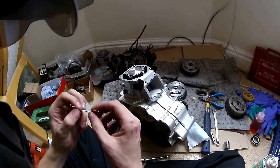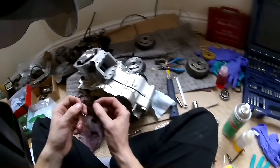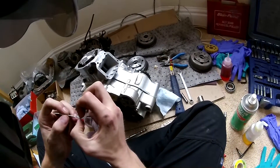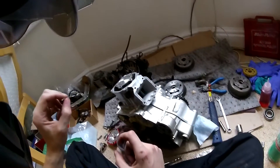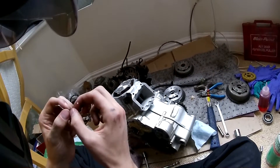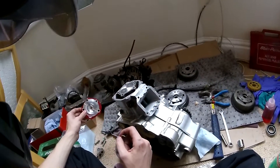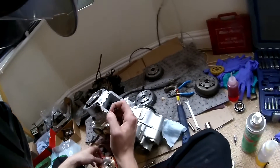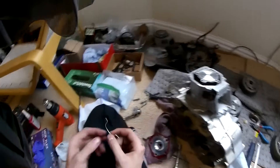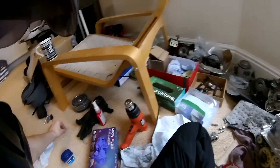Remove the head and there is our squashed solder. I'll get my calipers and measure the thickness. Hopefully it's somewhere over 0.8mm, but looking at it, considering the rest of the solder was 1.6mm, I'm not optimistic. I'm assuming I'm going to have to skim this head to get the squish down - I think it's going to be quite high. I won't be able to find out until Monday.